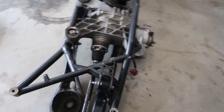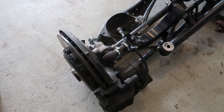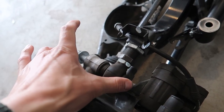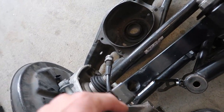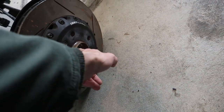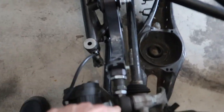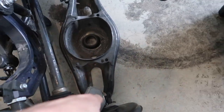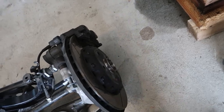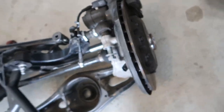After inspecting here for a while and making a mental note of everything, Shopdap had sent me a whole list of part numbers for hardware in the rear end. I'll probably reuse a lot of that, but I need new diff hardware. There's no axle bolt in there right now — interesting. We're gonna disconnect the camber arm, toe arm, get the axles off, and get the control arm off both ends. I'll try to sell these rotors; they've got a little surface rust but they're practically new.